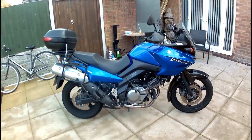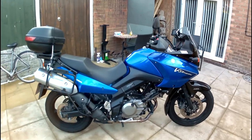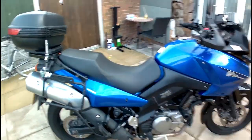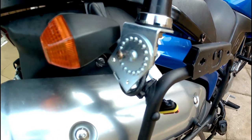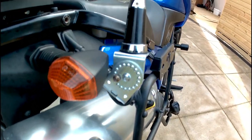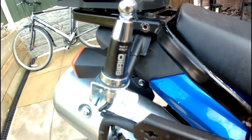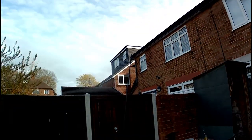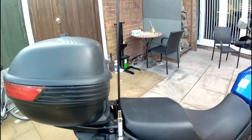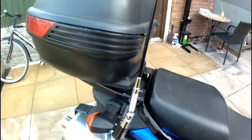I'll show you what I've done on my bike. We've already set up Baza's and I'm going to put a little bit of footage in showing me doing that. Here's mine — it's a 2007 V-Strom 650. What I've done is bolted a mounting bracket onto my pannier. I've then fitted this Sirio GL27 aerial, which doesn't need a ground plane — for those who know about radios, you'll understand that.